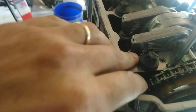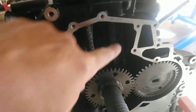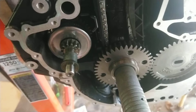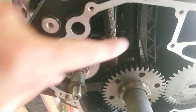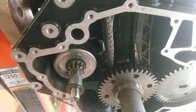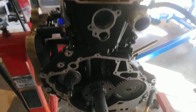Make sure you do not forget to put that plastic chain guide in there. Before you put any of this together, make sure you put this guide in because you cannot get it in there without the crank not being in the base of the block. Do not forget that before you even put that crank in — this piece has to go in there and the chain has to go over the sprocket. Once you lay that crank in there, you will not get that chain or that guide in. So remember that before you put all that stuff together.